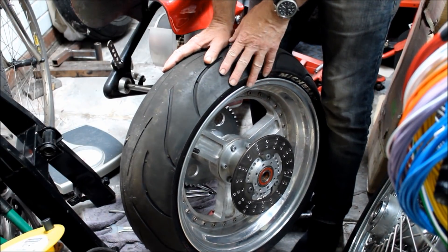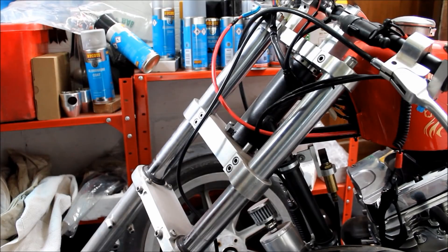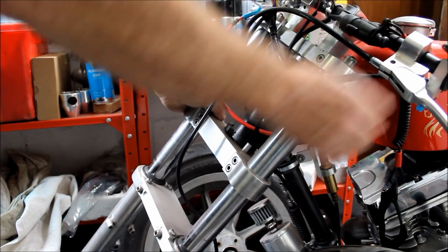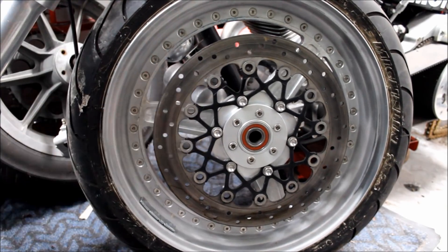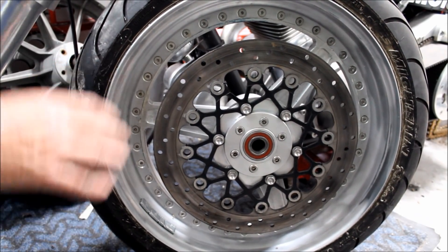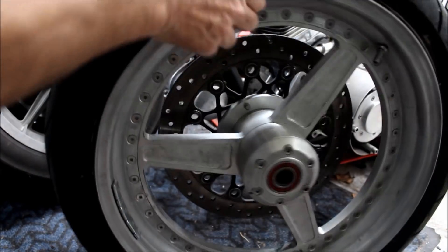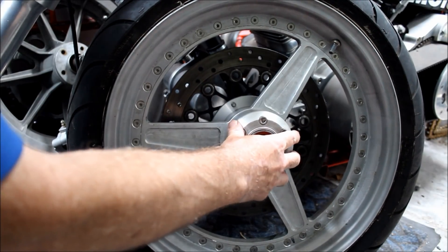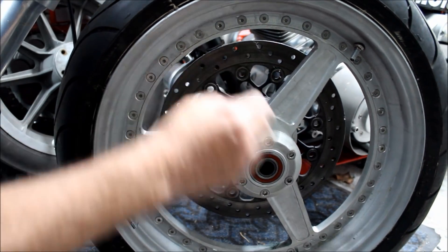Next I'm going to take the front end off this old drag bike and we'll see how that looks. Here's the front wheel off the bike — just like the rear wheel, it needs some work: polishing and cleaning up. But it's not looking too bad. One job I can do in the near future is fit a second disc to this wheel, because right now it's a single disc wheel with just a cap on this side. As you can see it's been drilled and tapped for bolts, so we can take that cap off and make a second mounting plate so I can mount a second disc on this side of the wheel.